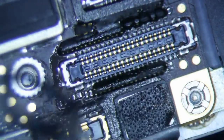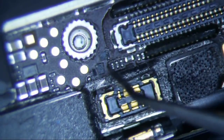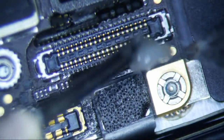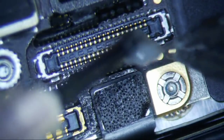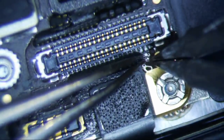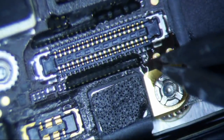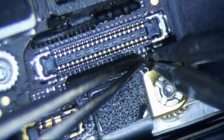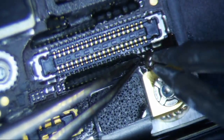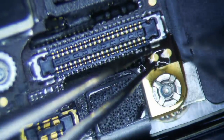I don't know why Apple decided to do this again. On the iPhone 8, it's usually these little transistors for the battery that are pried off, not these little things. They did this in the 5, 5S, and there were a lot of problems with it — people were replacing batteries and they jacked up those components all the time. Then they went away with it from the 6 series and up, and now they're kind of back to it. It's good for us I guess, but not good for the DIY community, which Apple seems to not really give a shit about.